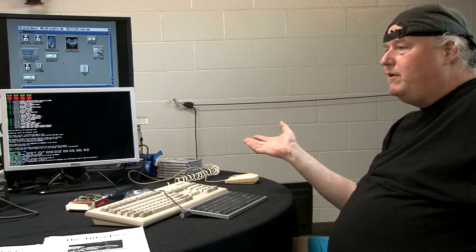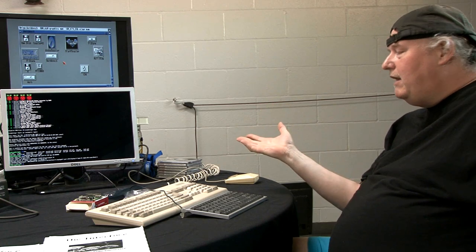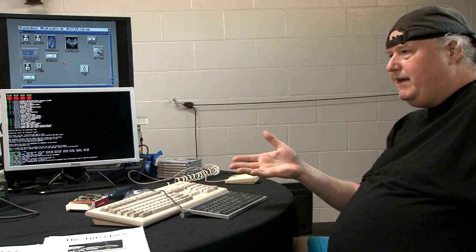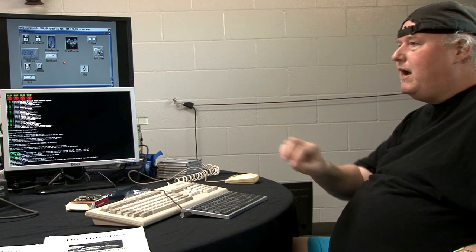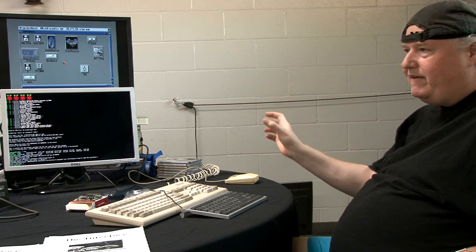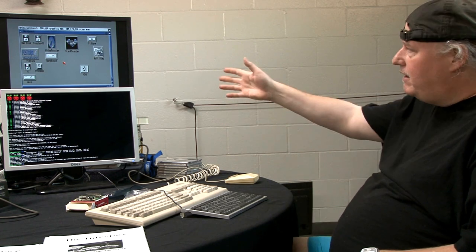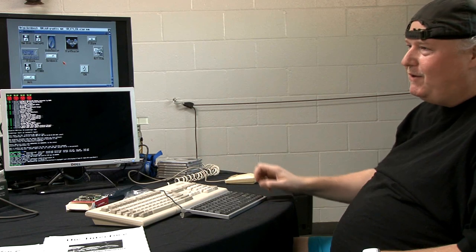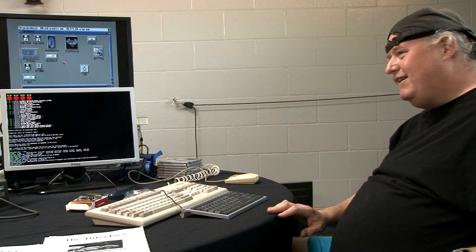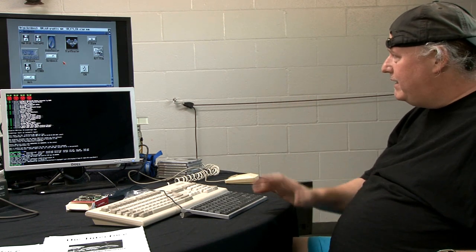I have to see the configuration files. But you can make more than one configuration file, a couple of them, and I was doing that at home. I had an SCP program set up, and I copy over the default configuration, make a copy of it, modify that and copy it back. Then I try different things. I noticed I could add more RAM, so I went to 768 megs of RAM. We'll push it a little bit, but I noticed anything over 128 gets unstable. So eventually I just came right back down to the default.